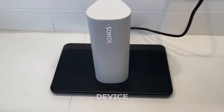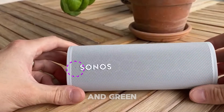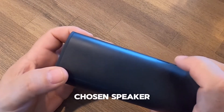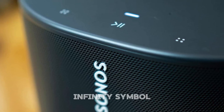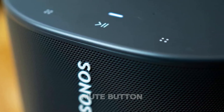Wait for the app to connect to the device. You'll hear a chime from the speaker and its LED will flash white and green, indicating it's ready for the next step. On the chosen speaker, press the Join button. On newer models, this might be marked with an infinity symbol, but on older models it could be the Play, Pause, or Mute button.